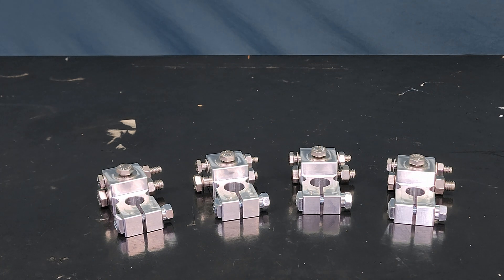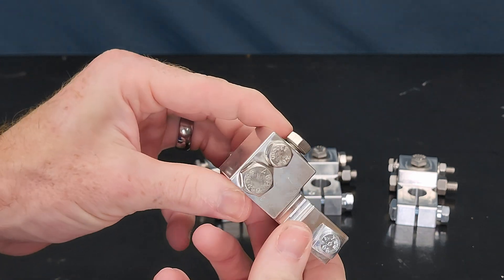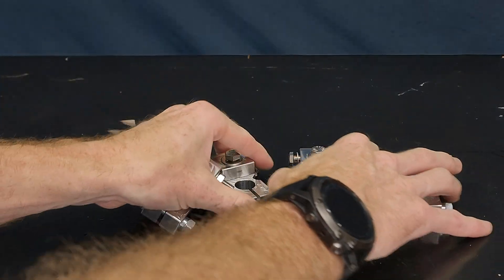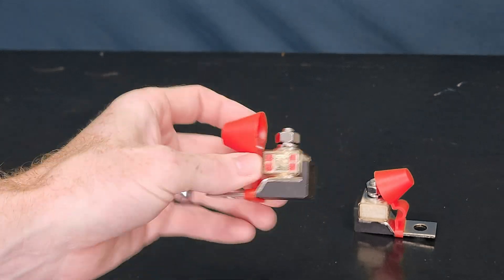Inside both of these boxes are the ICS upgraded battery terminals. They're upgraded because they're a better conductor — I believe they're made of aluminum. They also have extra mounting points for auxiliary things such as winches, lights, coolers — things like that — so you can tie down to those on both batteries. I've got one set for the starter battery and one set for the dual battery. This is a fuse kit for the main battery and the auxiliary battery. The wire from the main battery to the dual battery is going to be a fused wire, and from the dual battery to the RedArc charger will also be fused. You never want to run wires on electrical systems that aren't fused in case they get hit, nicked, or cut — and burn down your vehicle. Always fuse your wires.